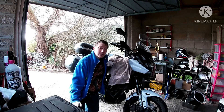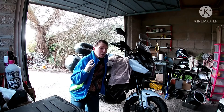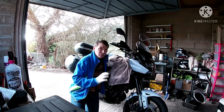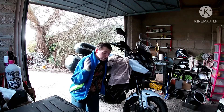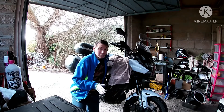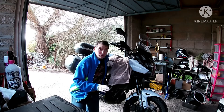So what I'm going to do is basically just a quick clean out. This is not going to be taking seals out and rebuilding from scratch or a full bleed through. This is just a quick clean out which I tend to do every six to eight weeks, especially around winter time. Just as a little cheat, I should let you know I did these calipers about two or three weeks ago so they're going to look relatively clean, but the process is the same and I also fitted brand new brake pads.